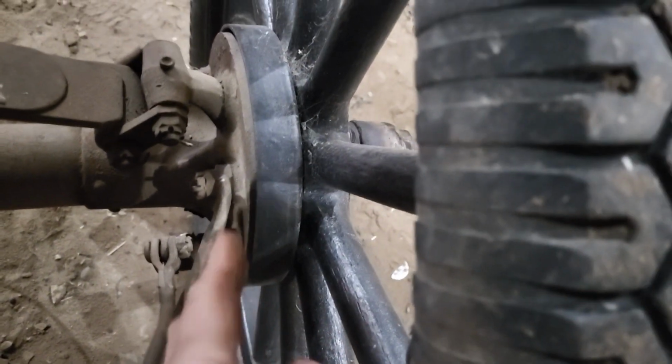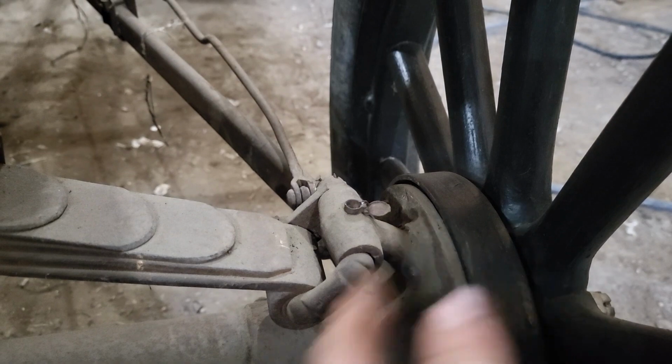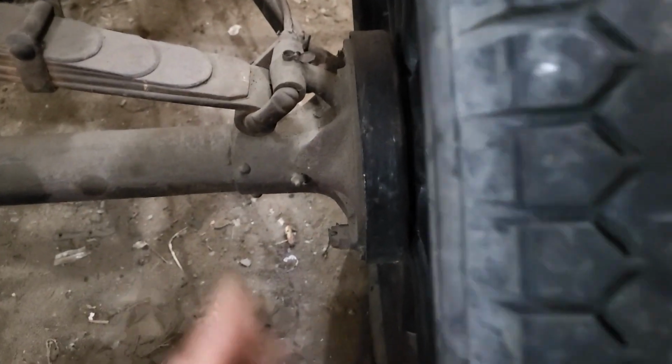The other issue with this lever was with the brake. The park brake rods attached, these are seized in the, I don't know what that's called. It's not a drum, but the backing plate, I guess, kind of deal. Yeah, those shafts are both seized. So when you tried to pull on that lever, these rods were just bending because they couldn't move, because this guy's seized in here.